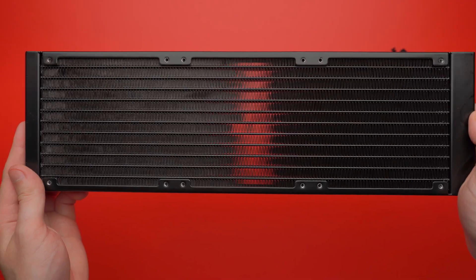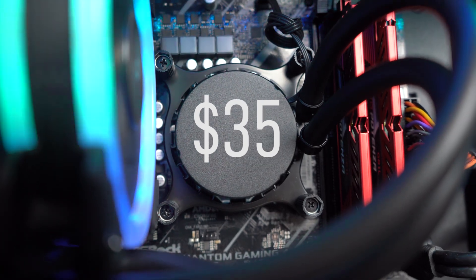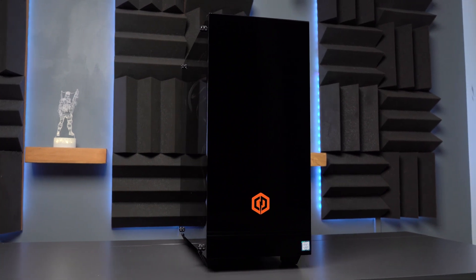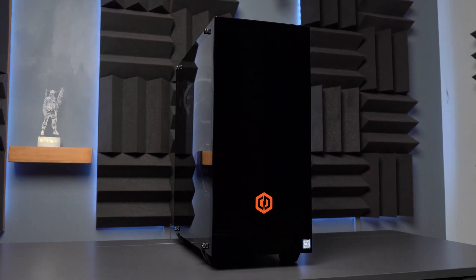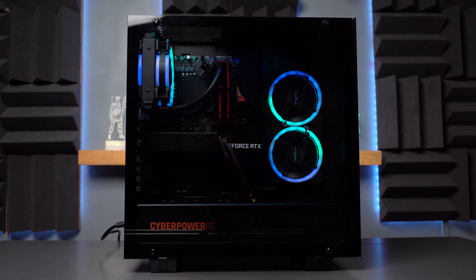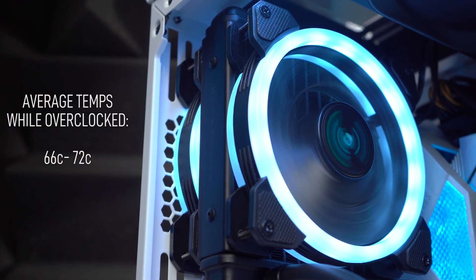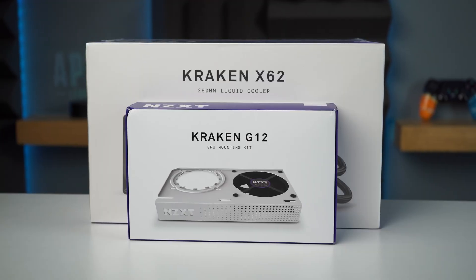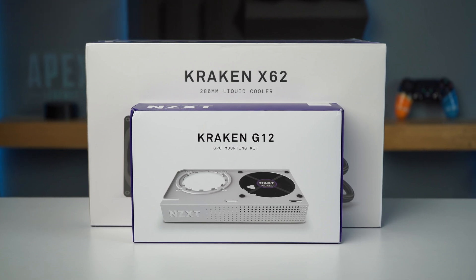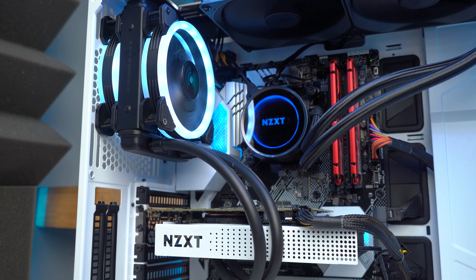We're going to look at basic performance and pricing from a range of all-in-one coolers. First off, my $35 baseline Asetek 120mm AIO that came with my CyberPower pre-build is a savage for the price — it kept my CPU at 66 to 72 degrees Celsius even when overclocked. I always ran a dual fan exhaust setup on this radiator to maximize airflow, and it always excelled.